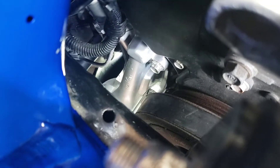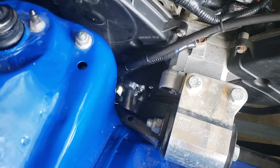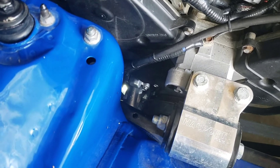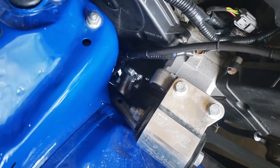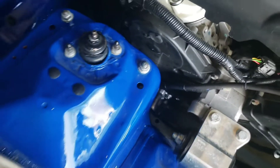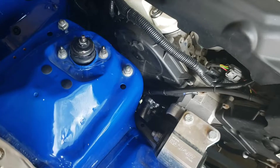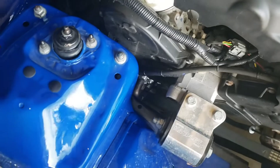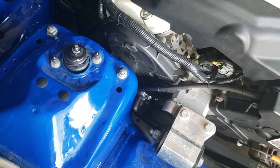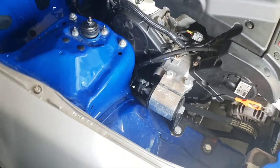Make sure you have no leaks. If you are having a leak right around the passenger side, that will be the first one I would check. All the J-series engines I've ever owned pretty much leaked from there, so ten bucks worth of seals should take care of the issue. If you have an actual TL you won't have any clearance issues, but mine is in a swap shell so the space is a lot tighter — I had to use different swivels and right angles to get to the bolts. Overall it wasn't too bad, probably about ten minutes of work.